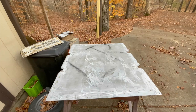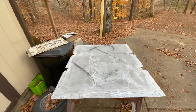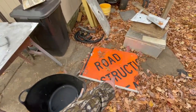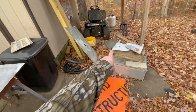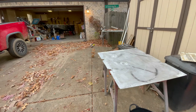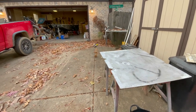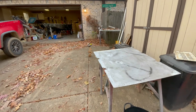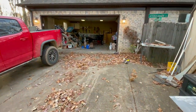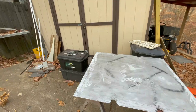This thing had carpet — that indoor-outdoor carpet — glued down with some kind of super duty glue, F26 or similar. I took a mouse sander and a flap disc and cleaned it up pretty good. I'll probably go over it one more time with a mouse sander before we put the hydro turf on. That's the front part, and we have the deck and the little bulkhead too. They had screws holding it down — I'm not going to do screws, I'm going to do countersink rivets. Screws can back out, and stainless on aluminum contact isn't great. Aluminum screws wouldn't be great either, so aluminum rivets is how we're going.